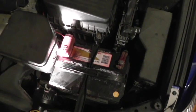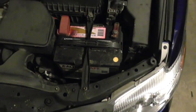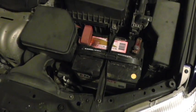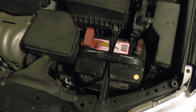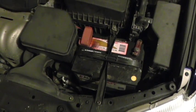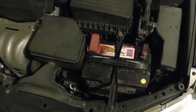I'll put the cap back on to keep everything isolated so we don't have any shorts. If you can find another source of power underneath the dash that can safely connect without drawing too much current and causing issues to your electrical system or even overload — be careful, because most of the wires in cars now are very small gauge, maybe 18 or 19 gauge. You can't put too much load on them or you'll melt them and your car could catch fire. Connecting directly to the battery is the safest way to do it. Enjoy, thanks.